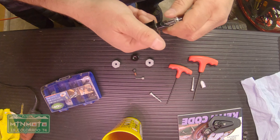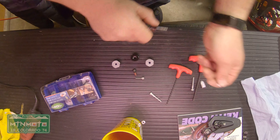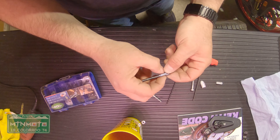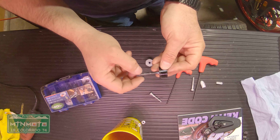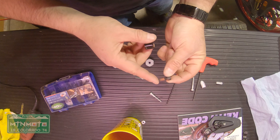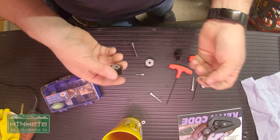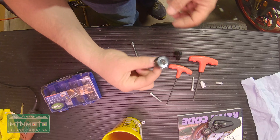We need to turn this into something nice and smooth. It looks a little rough but you'll never see it — it'll be wedged right in there. I might paint and touch that up as well. One thing that is key: the bolts that come with your CRG bar end adapters have a throat — you can't use those because the threads don't go all the way down. We actually need an M6 all-thread bolt — threads all the way down. This is M6 18mm I think, and this one's about 20mm, a little bit longer.